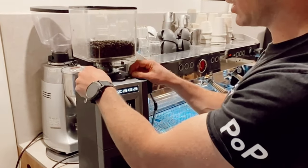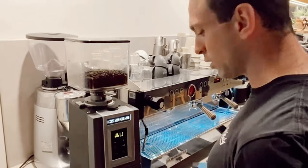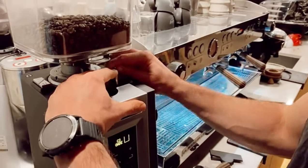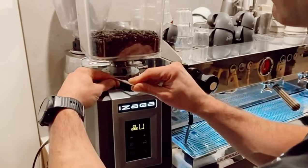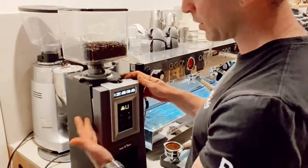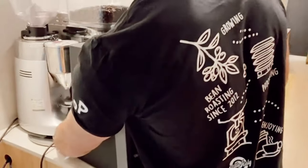As you can see, this is usually where your rubber protection mat sits — you can just pop that off. Grab your allen key that comes with your cleaning set and slightly loosen each screw. You don't need to take it off all the way, just loosen it enough so it can come forward. Be very careful when you pull it towards yourself, as there are two spikes holding the mainframe together. As an extra precaution, I'd even take out the power source just to make sure.